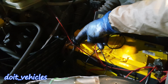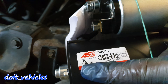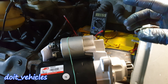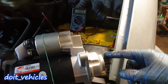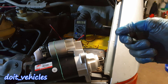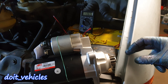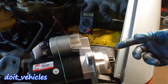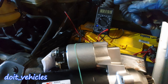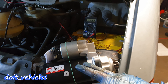Another component is the wiring from the battery. They are gonna be short and thick in order to deliver the amperage required for this motor to use 1.8 kW. If the connection is bad or it allows just a little bit of power, then this is not gonna be powerful enough to spin the flywheel. When you turn the key in the ignition you're gonna hear just a click, and that means the solenoid is engaged but it doesn't have enough power. So if you hear that click it means you might have a voltage drop or something that does not allow the full voltage and amperage to travel to the motor.